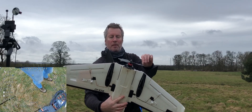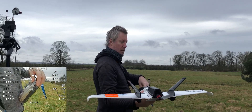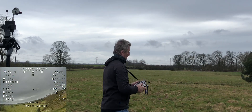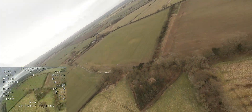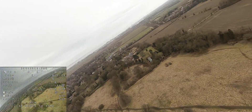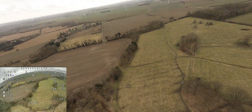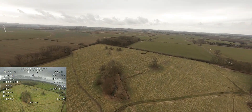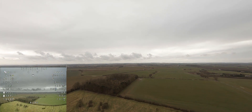So I've got the 8045 prop on now, so I'm a bit more nervous about this, but hopefully it'll be all right. Return to launch, ignition on. Sounds a bit more beefy. How many amps does it pull in? 3 amps at 25% throttle, 4 amps - 50% throttle, 13 amps.